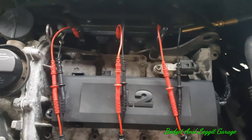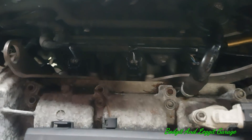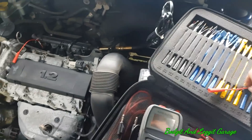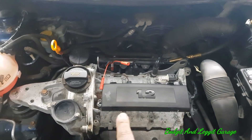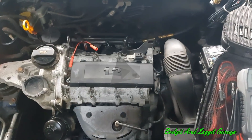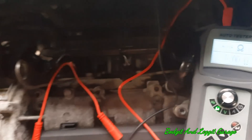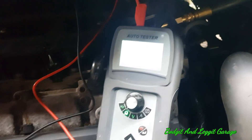What we're going to do next is a very quick ohms test on the injectors. We'll unclip the injectors and do a quick ohms test. We're using the Hobby Tools auto tester and test lead set. We've picked the right connections — the red ones — and back-probe the injector once the plug is removed. Turn on the meter, then touch the leads together first to make sure we've got zero, which we do, and now we can connect them to the injector.